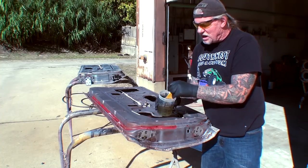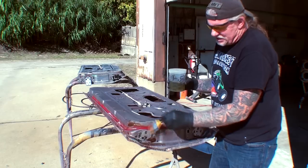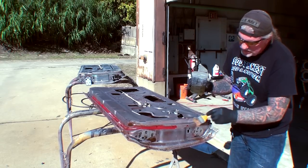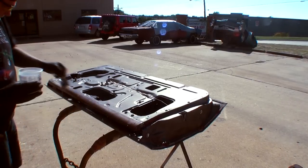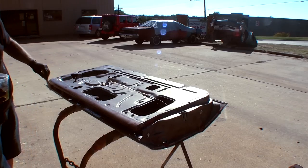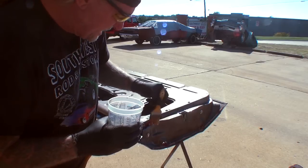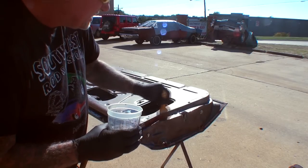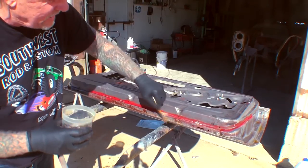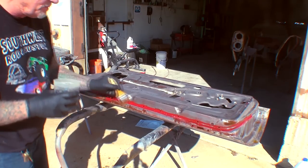What we're going to do is take our throwaway brush with our muriatic acid — this is 100%, I did not dilute it — and we're going to go ahead and brush it on just in the areas where we see surface rust. That's it. We're not going to brush the whole car with it, just where the surface rust is. I can already smell the acid as I'm brushing it on. We've got to do this door inside and out, so once I get done with the inside of this, I'll do the outside of the door as well. Now at the bottom of the door, this is where most of the surface rust is going to be — that's where moisture and dirt gets trapped, so you really want to make sure you get that really good.